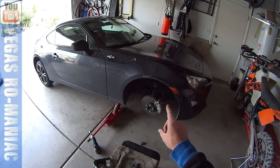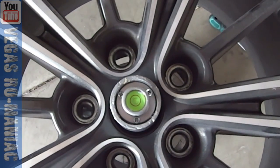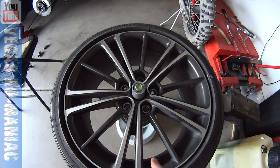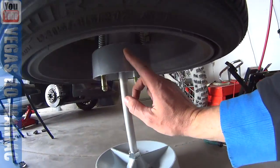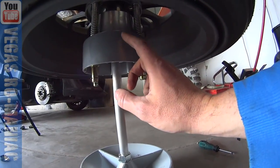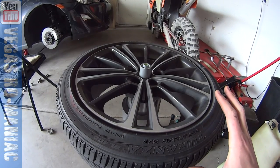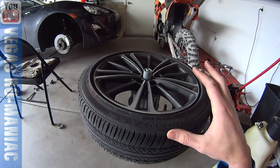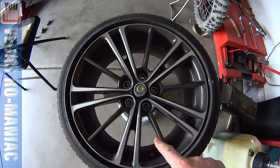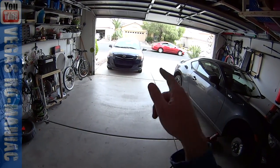This is my wife's car — we just brought it back with the tires balanced at a balance shop. I put it on my old trusty balancer and it shows it's right in the middle, so these tires are balanced. The only problem is that if I turn this part of the balancer 90 degrees, it gets off-balanced. This is the third tire balancer I'm trying and it's not accurate. What I'm trying to do right now is calibrate this balancer on a tire I know is balanced, to see if I can get those tires even better.